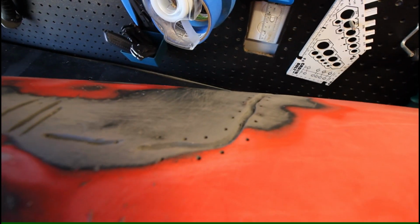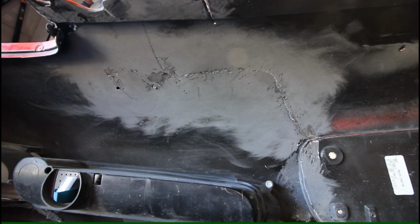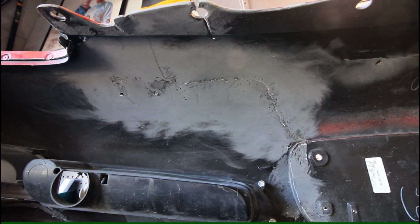One of the other things I did, mostly on the front side, was I grooved out the cracks, so there's some actual surface area for the epoxy to sit in, and it's not just sitting on the surface. On the back side it's going to be a little bit more of a rough repair, but I'm going to try and make it look as nice as possible as well. But yeah, I'm going to go ahead and start wiping the surface down with alcohol, and then I'll get the materials out and we can start getting ready to put it all on.